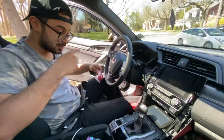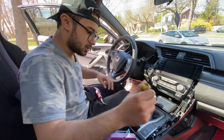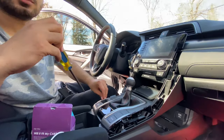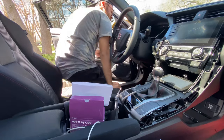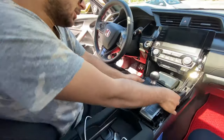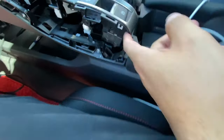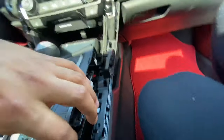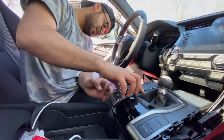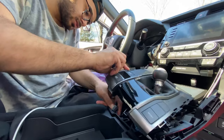As hard as that was, it's very scary because you think you're going to break it, but you won't. So let's go ahead and grab our Phillips and take these two screws out. There's going to be a clip on the side here — you press down and pull forward. Same thing on the other side. Here's the side with the clip. Now we've got one last one on this side.